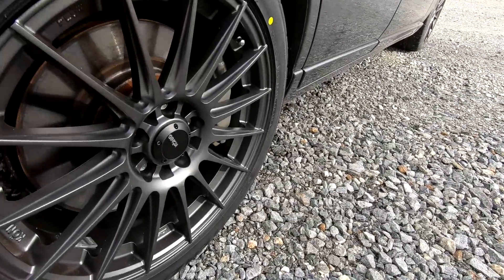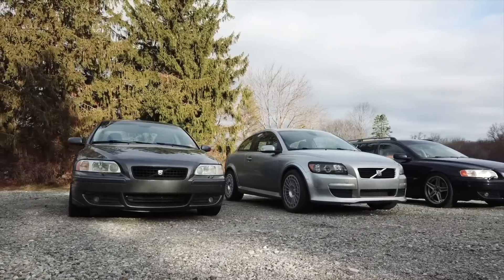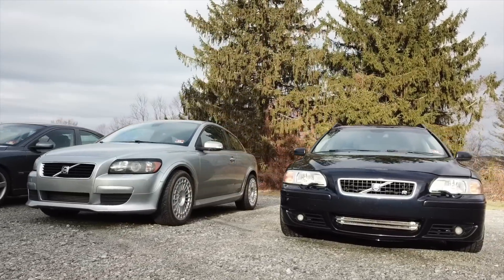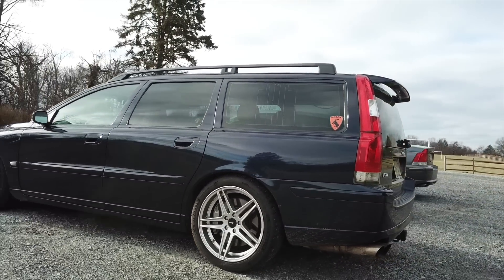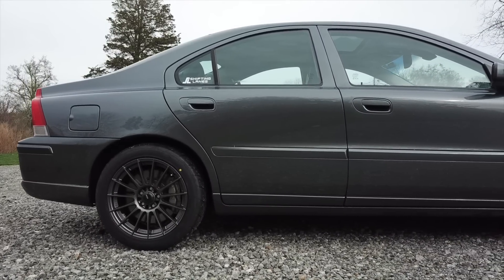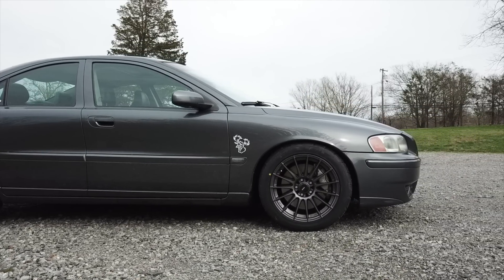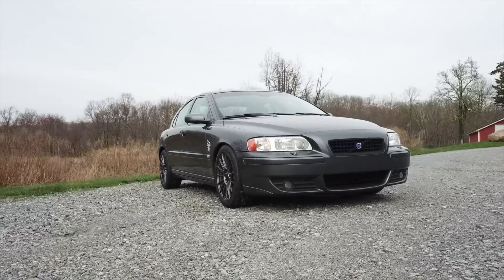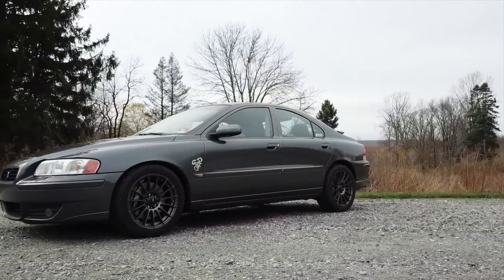The last reason is the bolt pattern. As most of you know, the bolt pattern on this car is 5x108 — what Volvo runs on the S60R, V70R, and C30. There really aren't a lot of lightweight wheel options in 5x108. I reached out to Facebook groups, and they suggested the OZ Ultra Leggeras, but those only come in 7.5-inch width for 17-inch wheels. Others suggested the Team Dynamics Pro Race 1.3 and braid wheels. Braid wheels are fully customizable, which is cool, but I didn't want to spend a lot of money. The Koenig Renform was basically the perfect wheel that fit my budget and this car.